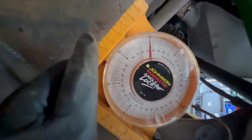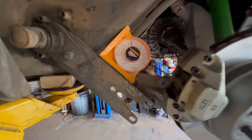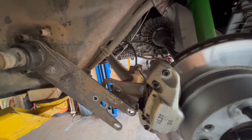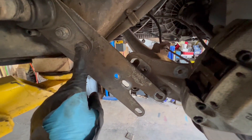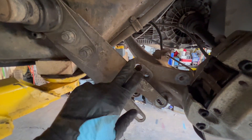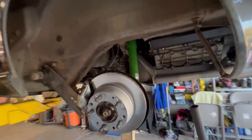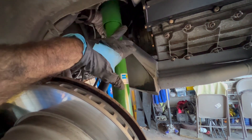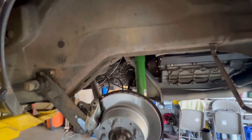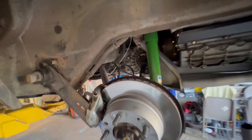Here I am with the back suspension - I've already done the other side. This is the driver's side and you can see it's at exactly 45 degrees, same as the other one. Now I just need to tighten everything up and put it all back together. The rear suspension is almost done. The only remaining thing is I need to order some shocks that are slightly longer - these will probably bottom out and won't give me much droop, so I'd rather get longer ones. I already took all the measurements - I think I need them about three inches longer.